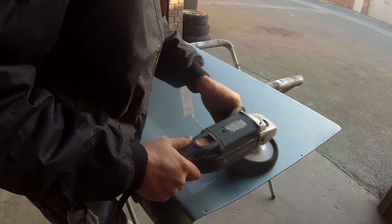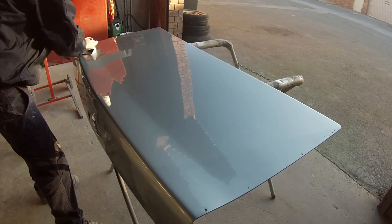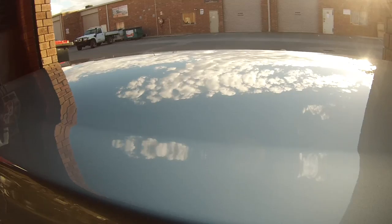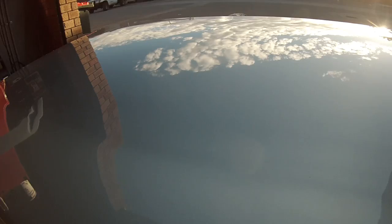For a colour like this I'm not going to use the orbital polisher to remove swirls because you're just not going to see them. It doesn't mean they're not there — they're still there — but because of the colour it doesn't reflect the light as much as a darker colour. If it was black, then yeah, I'd definitely use the orbital polisher. You can use a big full polisher, or just a normal standard orbital you sand your panel down with and put a foam pad on that. As you can see I've got quite a nice result — got quite happy with how it came up. There are one or two little waves or slight ripples in there but it's a forgiving colour for that.